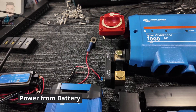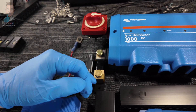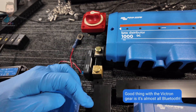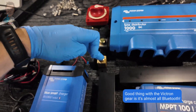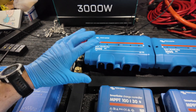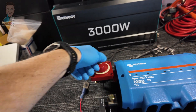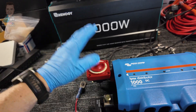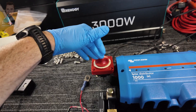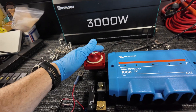For getting power in and out of the distribution, on our negative we have one of the Victron smart shunts, which sits in here really nicely off to the side. This will measure all of our current coming from this post, which will go to our battery, and give you the full readout of exactly what's going in and out of your system. At the top, it's really important that you have a master disconnect switch — this is the positive battery in, only one lead from the battery, and that will turn off the entire system with just the one main switch.